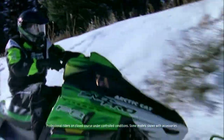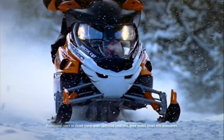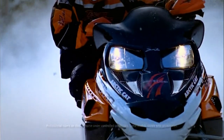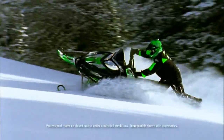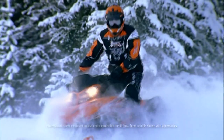The goals that we now had were clean and responsive and good horsepower. And you put that all together and you get a package like the 800, which is so much more responsive than a 700 was. On the 800s, with the pipe sensor, knock sensor, and the EFI mapping refinements, it's just clean. It's sharp, it's crisp. You grab a handful, you're gonna feel it. Just has that responsive, strong feeling just because of such a high torque curve, a lot of mid-range torque.